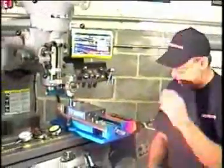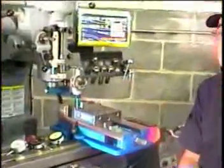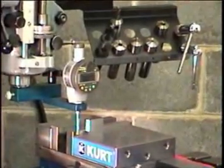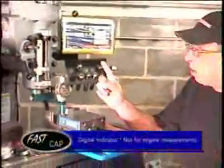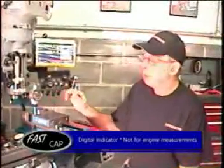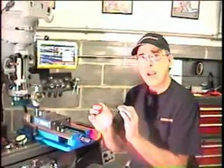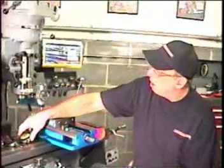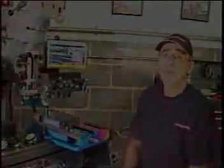The last indicator — if my memory is correct, it was around $400 and it was very accurate. But I don't really recommend it. It's a little difficult to use. If you're trying to measure base circle runout on a camshaft or degree a cam, you've got the hand moving back and forth — you can see where it's going with a dial, but with this thing you've got numbers going up and down, and it can be pretty difficult to read. It's really hard to hit exactly 50 thousandths when checking cam duration. So I would say, if you can afford it, I would go with the $80 to $100 one — it seemed to be the best bang for the buck.